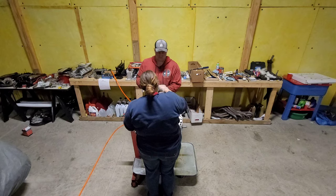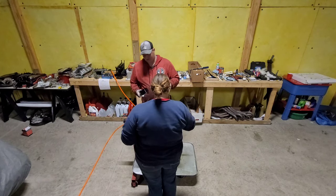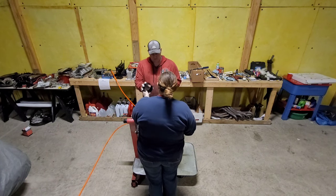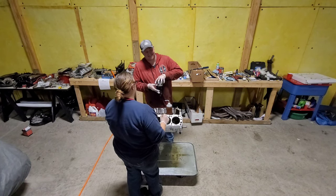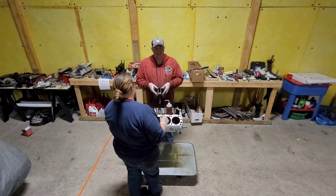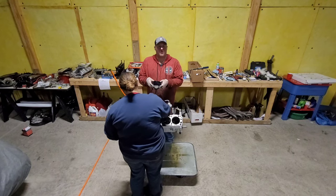You should be fine. Okay, so now she's oiling up the cylinder. We got oil on our oil rings. You wanna go ahead and put some liquid dinosaur in here? The absolute beautiful part about this piece, like I said, you just gotta drop it down in here. Not the piston, you know. Don't drop the piston. Look at that. Boom. We are in to the bottom, ready to go on the block.